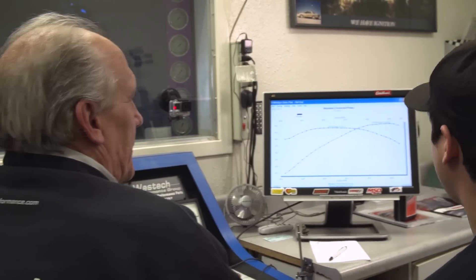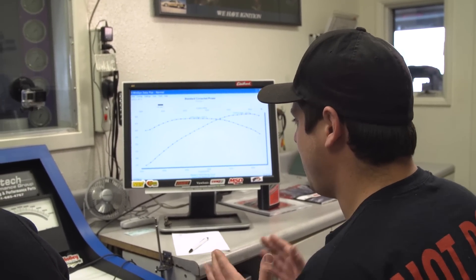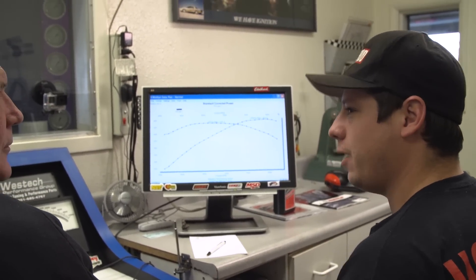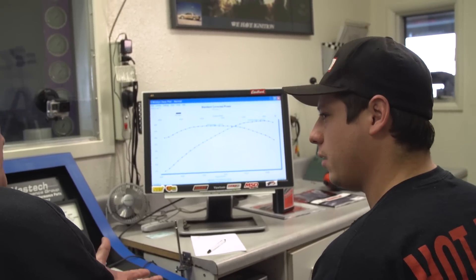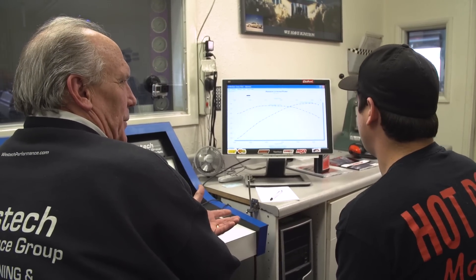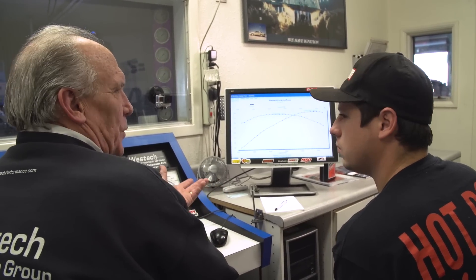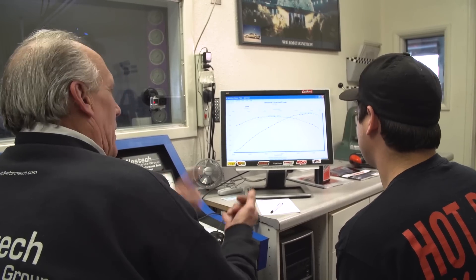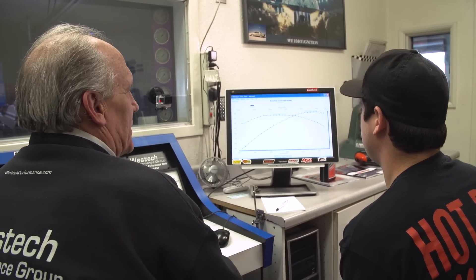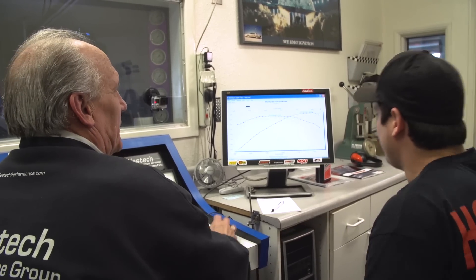What we really want to test today is — we could build a motor we could zing to 8,500 RPM — but does that make it worth it for the average guy to go out and get a piston that has a thin ring pack? The reality is race car guys are already doing narrow ring packs, so they've already headed in that direction. I think the question for us is, is it worth it in a street car? Power versus longevity and those sorts of things. I guess we get to go get dirty and find out. The easy part's over — now we've got to go take it apart.